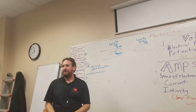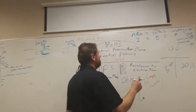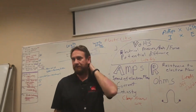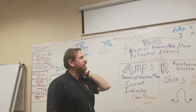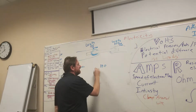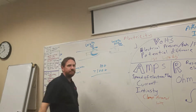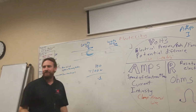Maybe it's 1,000. So let's do it with 1,000. What is 100 watts divided by 1,000 volts? Put it in your calculator the right way. Put in 100 first, then hit the divide sign, then hit 1,000. 0.1. So now I have 0.1 amps.